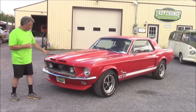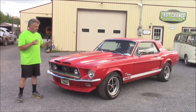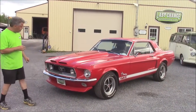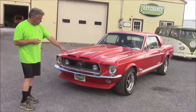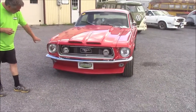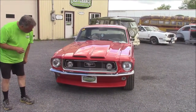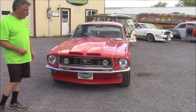It's a one-off hood — custom-made, the only one the company made for us. It's fiberglass, where the rest of the whole car is steel. You can see in the front we have the GT looking front end with the authentic GT lights inset on either side of the grille. We've upgraded the lights to halogen, with LEDs around the outside for the marker lights and H4 bulbs. Down below we've got a little chin spoiler painted to match the car.